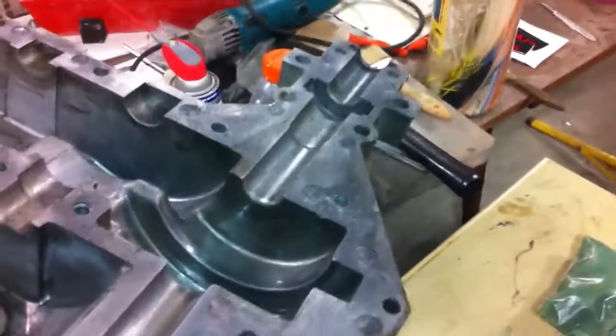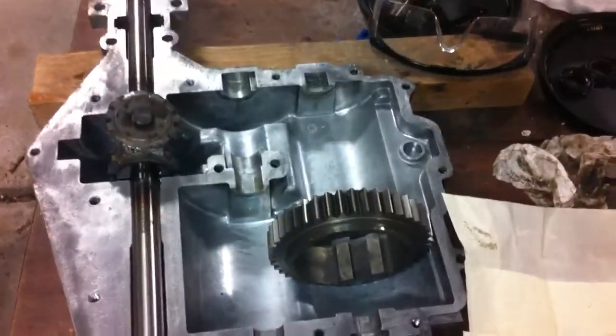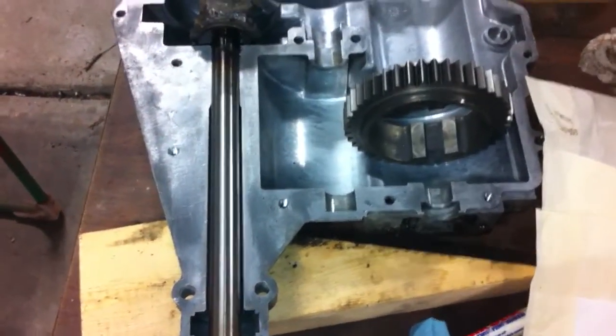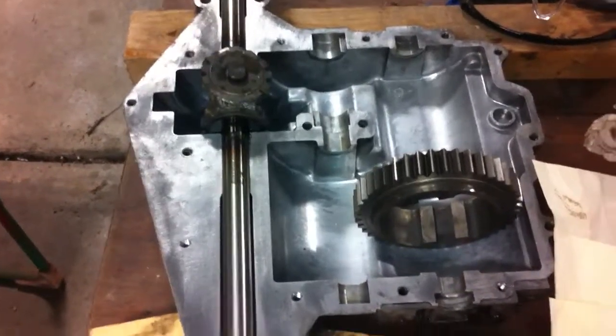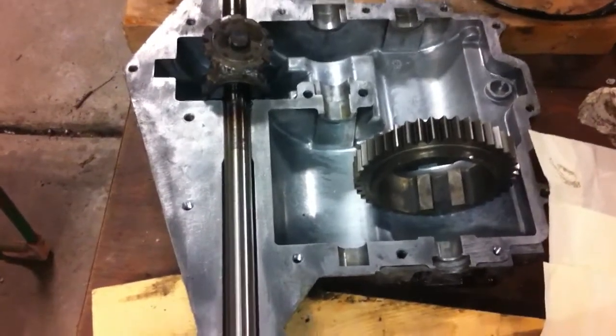I just cleaned the cases up — they had that gray RTV. I just blasted it with some brake cleaner and hit it with one of those small little three-for-a-buck wire brushes, just sat there and scrubbed at it, and the stuff came right off, no problem. I don't really like the RTV though — I like the anaerobic sealant, because where it oozes out, it won't dry. It only dries between the two case surfaces; if it oozes into the case, it stays wet, like if you just squeezed it out of the tube.